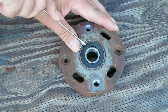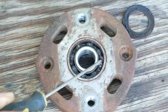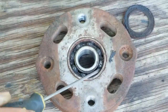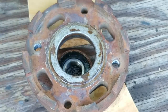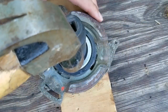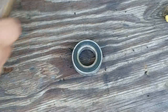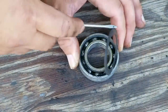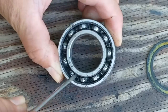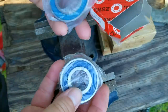One of the coolest features on this mower is the blade clutch. This will allow you to keep the engine running while not having to worry about the blade. However, this feature is a complete luxury and is not needed — when these fail, most often the bearings will seize up. If you're not able to replace them yourself, get ready for a hefty repair bill. Remember, when not using the blade, the bearings will take the load, and these do not last forever. The bearings are not expensive, and if you have the right tools or a big enough hammer, it's not tough to replace them — but for most, replacing them themselves is out of the question.